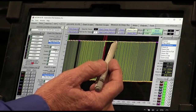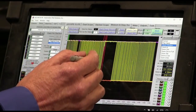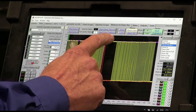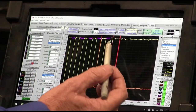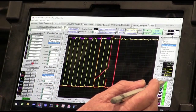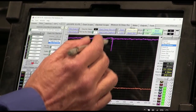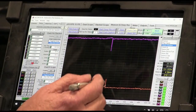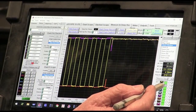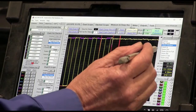We can see where it went high right here. And it's right when we fired that coil. That's the number 1 coil. And we can see that downward hit right there in the crank sensor. We can also see it, look at that, in the 5 volt and the ground. Both of those took a pretty good hit right there when we fired that coil.